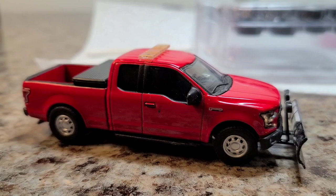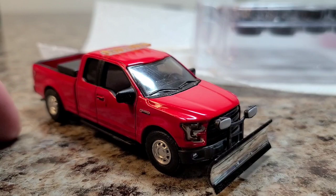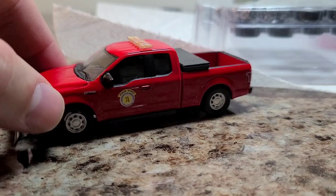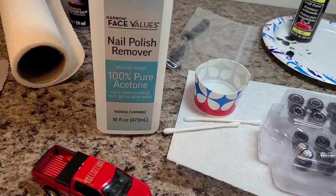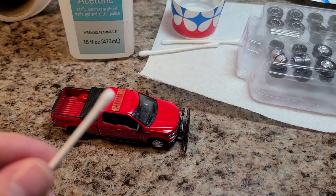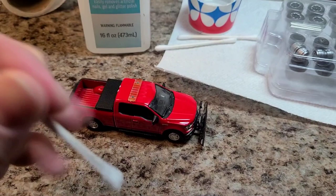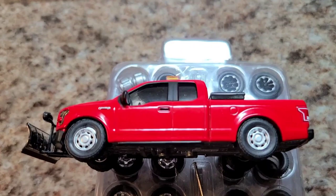So we've got our first side removed. Came out super clean. You can see there was kind of a factory black paint smear. Maybe I'll try to get that off, but whatever — it's a work truck, you get little rocks and things fly up from the road and hit the door. Still have the other side to go. You can see there's how it came, and here's what it looks like removed. I just took acetone, poured it in a little dixie cup, and took some Q-tips — just get the tiniest bit on, roll it and pull a little bit, use the clean side. Make sure there's nothing left and it'll smear the decal a little bit around. After a couple of go-overs it'll just be gone.